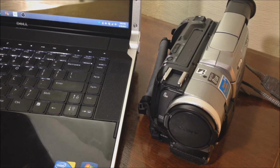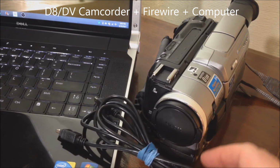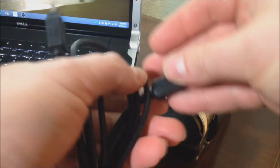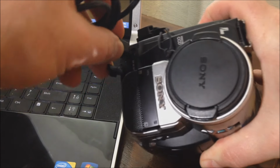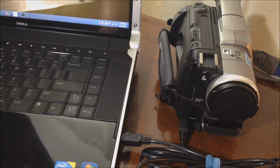So at this point, you should have a digital camcorder like the ones we've discussed. You should have your FireWire cable, which I'll put a link to down in the description. And you're going to need a computer with a FireWire port. So let's get started. First, we're going to plug the FireWire cable into the front of the camcorder. Plug the other end to the 1394 port.